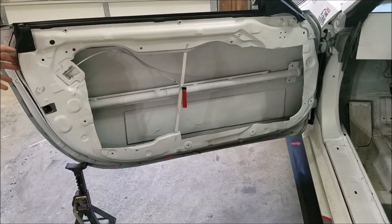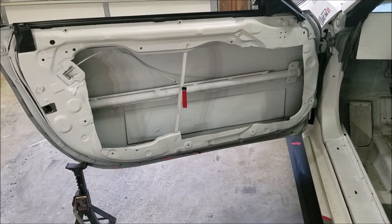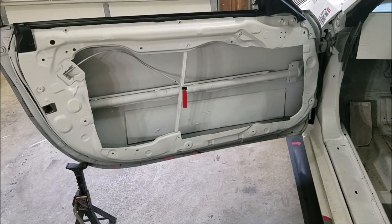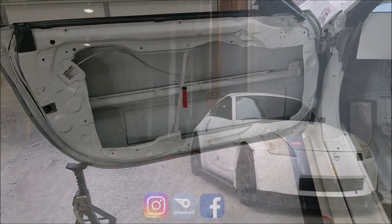The fiberglass door is really just going to be an outside skin to keep the silhouette of the car, keep air out, and keep air flowing smoothly down the side. I'll have a little bit of inner structure to give it some strength, and it'll mount the mirror. I may go to some sort of inboard mirror to reduce drag. That should take that 55 pound door down to only five or ten pounds, because the protection function moves from the door to the cage. That will save over a hundred pounds off the car between both doors on a car that already weighs 2,700 pounds.